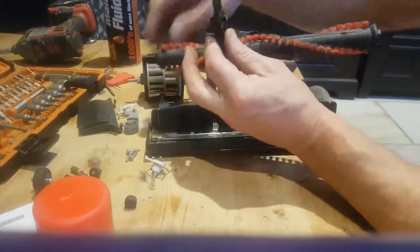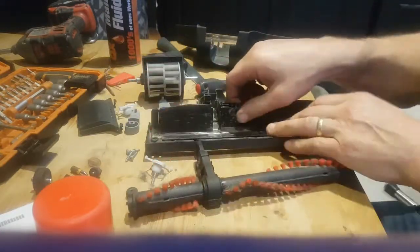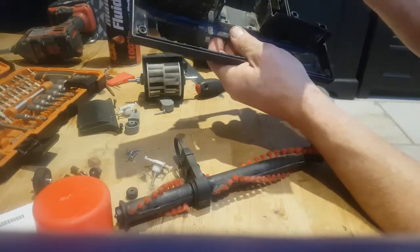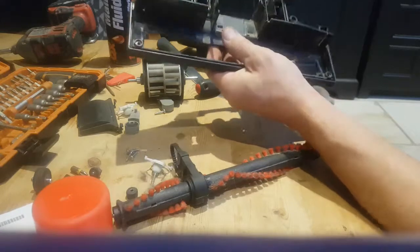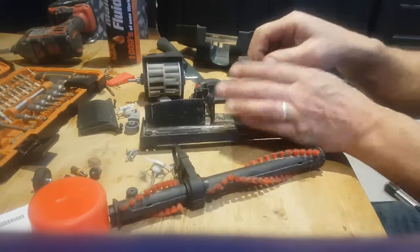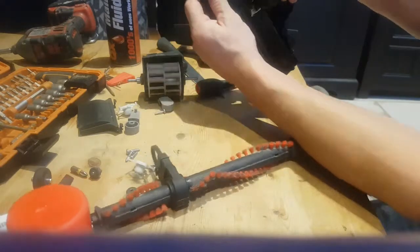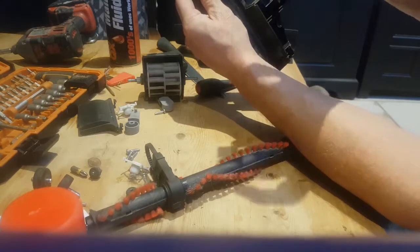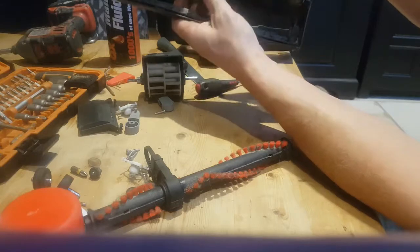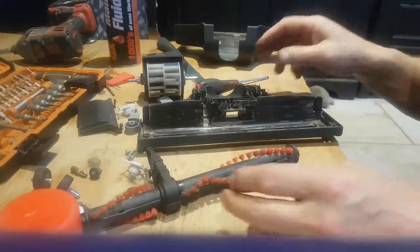Two ends off and there's your drive belt with your brush on the end. There's a little bit in the middle - it's a guide, just pull that out and make sure it's clean. Once it's all done, give it a clean. Slide this piece back in here, guide on the side, and two guides here - slide that in so you've got your scoop going that way.